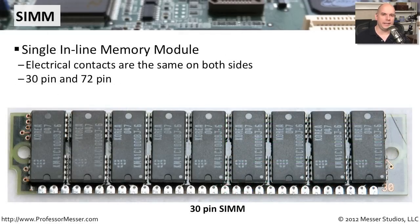You will unlikely ever see a Single Inline Memory Module, or SIMM, on any modern motherboard — it's even hard to find on old motherboards. This was one of the very first types of memory packaged as a module, where everything was on one unit. Prior to this, memory chips were separate and had to be installed individually onto a motherboard. The SIMM brought a modular approach where all chips were packaged together in one standardized slot. The 'single' in SIMM refers to the contacts at the bottom — they are the same on both the front and back, sharing a single inline connector.